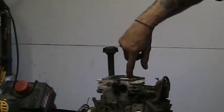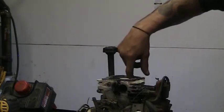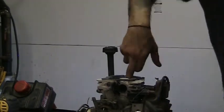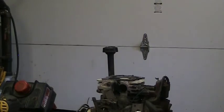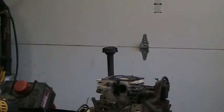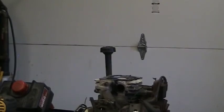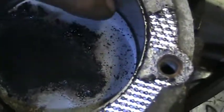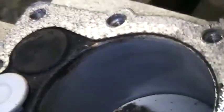That piston is surprisingly clean. Very surprising. One score mark in there that was going to lose compression. Just a slight amount. I think this thing was recently repaired. Let me pop you out of the stand. It's easier to bring you to the engine than it is to bring the engine over here. I want you to see that piston. Oh, settle. How clean that thing is. Spotless on, well, here. It's kind of mucky here. And that goop I was talking about when I had the head off is just right along the edge here. It looks like it was just some gum and varnish and crap.